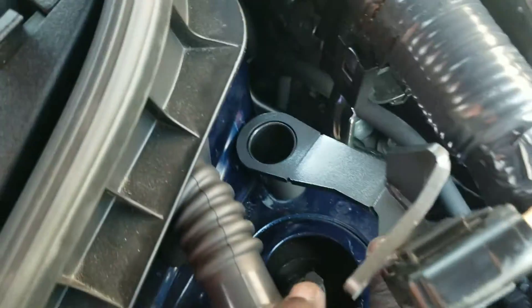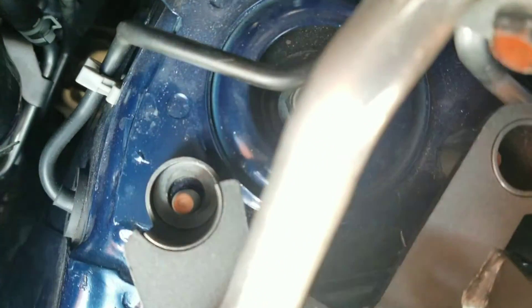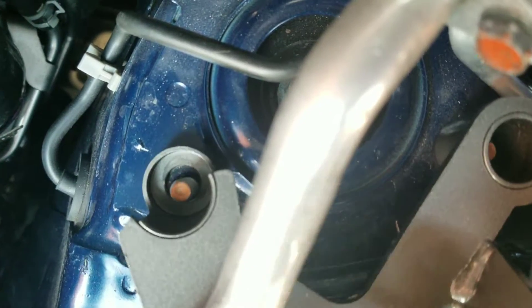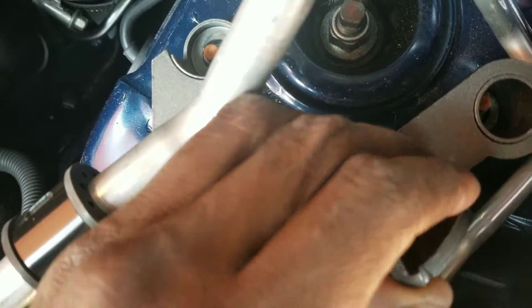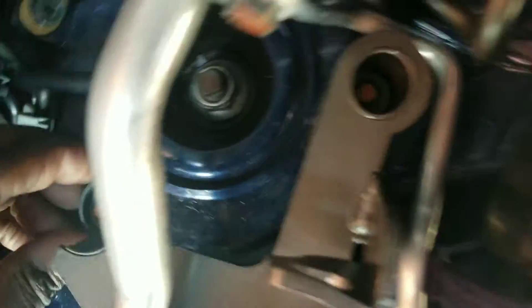I want to make this the quickest video I can. Move all the harnesses out of the way. Remember, this is not necessarily an installation video, but because I'm doing it again I want you guys to know what you're doing. Look at this bracket — you see how that hole is kind of off-centered? This could be another reason why my installation is going wrong. Because if I move it this way, the bar is going to be a lot closer. But if I move it backwards, that gives me probably another 5 to 10 millimeters of length for the bar. So I'm going to try to bolt it in at a far outward angle rather than in.